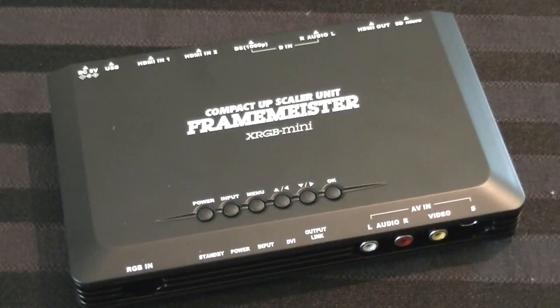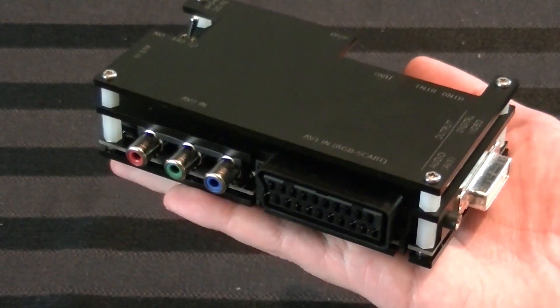So if you take a look at the device, it has composite, S-Video, and then finally RGB. RGB is the one I really care about, because if you do it correctly, you will get beautiful image clarity out of the TurboGrafx-16. It's worth noting that composite and S-Video ports are very standard — if you're in North America, these are easy to find. The RGB one is the more confusing one, because RGB SCART doesn't exist in North America — we never had it. So in order to use it here, you have to have a device like the SCART HDMI device, the Framemeister, or the OSSC. You just have to have that to use RGB in North America.